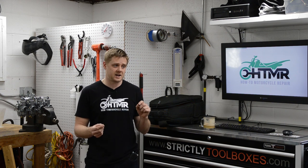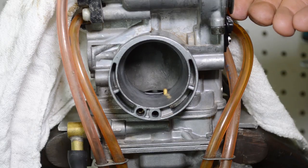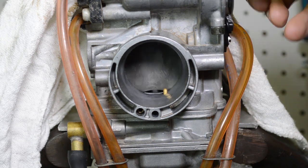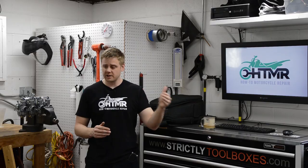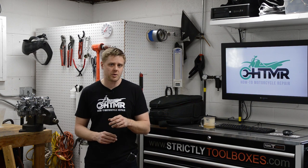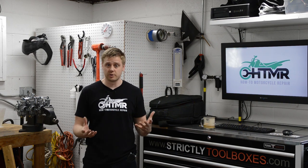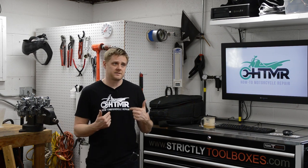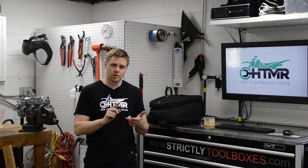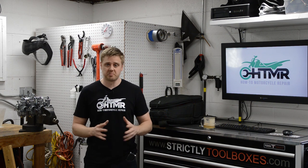Another thing is I clogged the accelerator pump squirt nozzle that shoots fuel into the carburetor. I completely packed that with soda because I didn't mask it off or plug it. Luckily, I was able to free it up in the ultrasonic tank. I just dunked it in there, but it still took a good hour to break the nozzle passage opening free of the soda media. If I ever have to do a carb like that again, I'm sure as hell going to mask that off with Play-Doh, clay, masking tape or whatever, and plug up those orifices so they don't get packed with media.